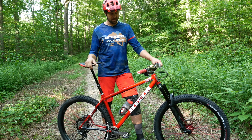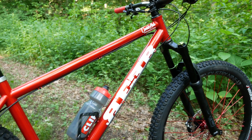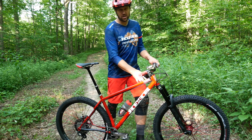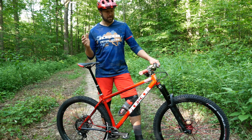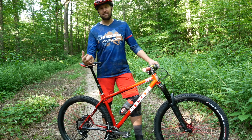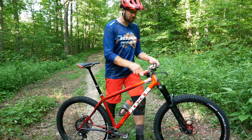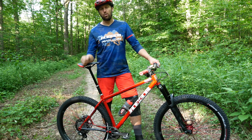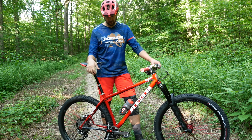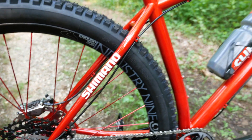Here's a couple details on this bike. This is a full chromoly frame. The reach number for an extra large is 19.5 inches. The reach on this bike is a little bit longer than an XL Diculous 2. The Diculous 2 has a 67-degree head tube angle; this bike has a 65-degree head angle. We also lowered the stack height so I get my bars a little bit lower.